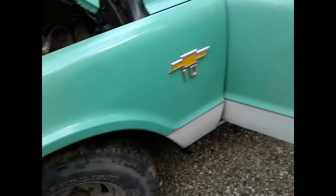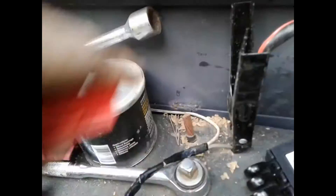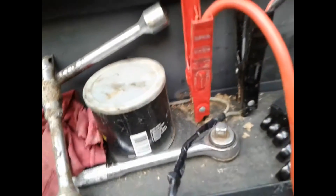Your hot is coming from this big terminal. This is not a store-bought connector — what this is, is a piece of copper tubing. I beat the tubing flat here, drilled the hole in it, crimped it on the end of this 2-gauge wire, and on this end I just left the bare wire so you can hook the jumper cable straight down onto it. It's just the bare copper wire, hooked on like that.